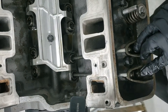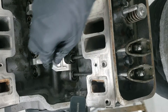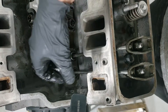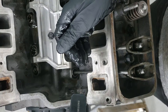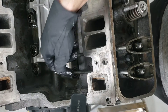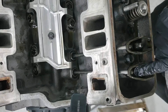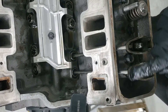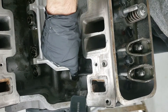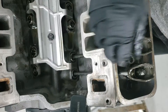By doing this one quarter turn, what it's doing is — this plunger is like a little pump. It can go in and out, it's spring loaded, and it's also pressurized by the oil. Whenever this plunger moves up and down, it actually pumps oil up the push rod and it comes out the little orifice on the rocker to help lubricate everything up on top. So you have to have this thing with some kind of preload. You can't have it at zero lash — it has to have some kind of a load on it.